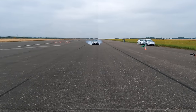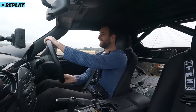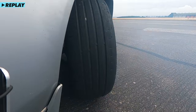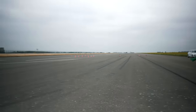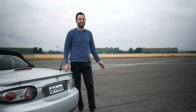And this actually shows a key benefit of ABS perfectly. As the tyres were locked up, I had zero steering — even though the wheels would turn, the car carried on going in a straight line. However, I instinctively got off the brakes, as you do a lot in a race car after a lock-up, and then the tyres began rolling again and the car turned. Because of this I was able to just about miss the camera. It added 20 meters — I stopped at 66 meters whereas it was 45 before. Which is just mad; I didn't think it would make that much difference.